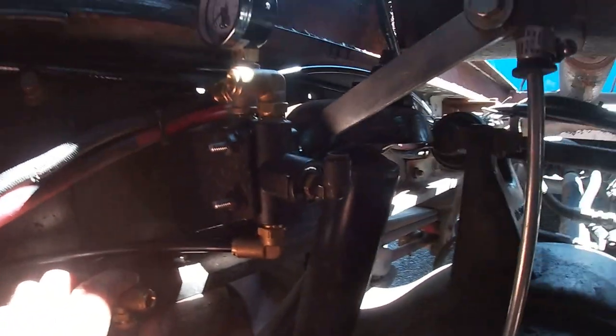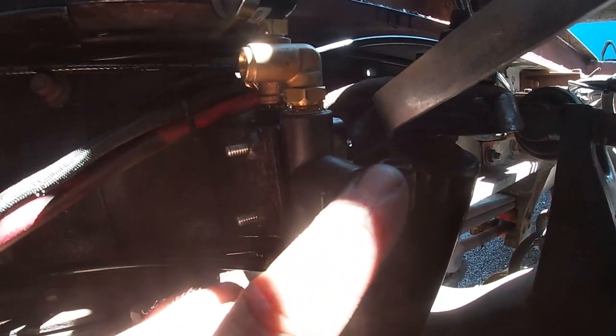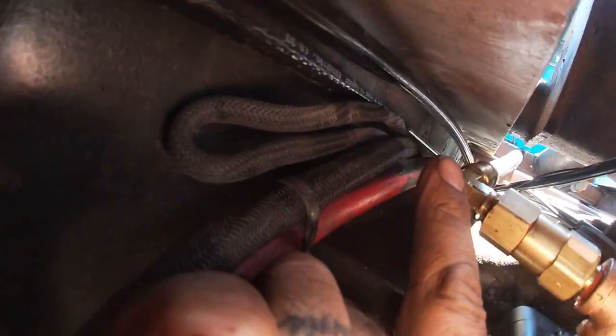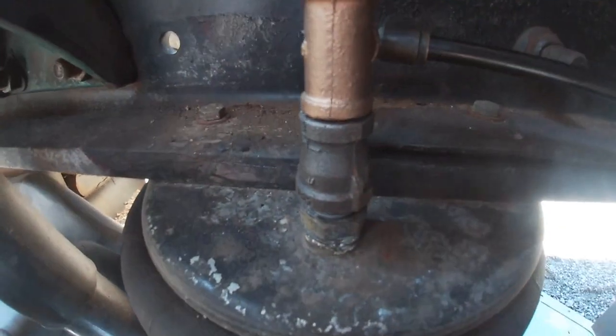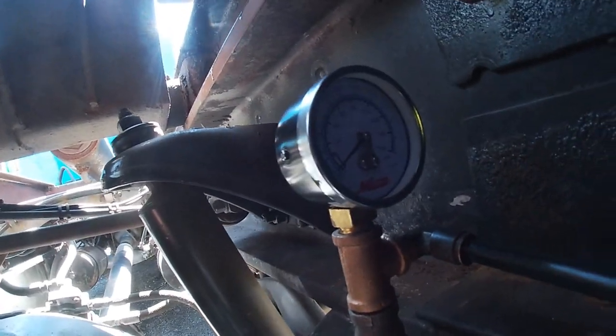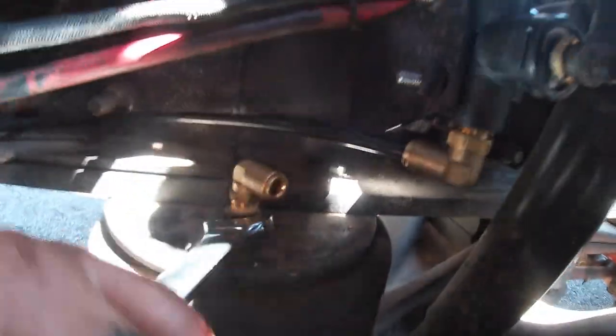I got the valve in. The gauge is facing backwards, the rod is hooked up, the dump connection isn't hooked up yet. The one-way check valve is plumbed in, the supply line is on, the bottom line is looped around the pintle hitch plate sitting on top neatly, going over to the other bag. Got the bag gauge plumbed in facing backwards so we can see how much air pressure we're getting in the bags. Just gotta tighten this one last fitting, but there's no room in here, so it's kind of hard to film.